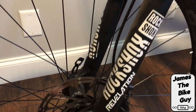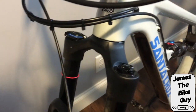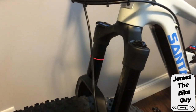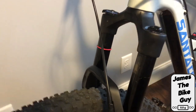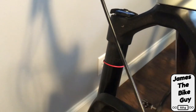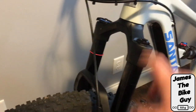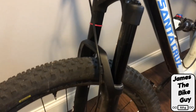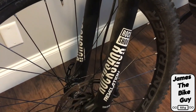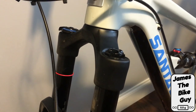In this case we've got a RockShox Revelation — the new 35mm, so this is similar to a Pike. When I was out on the trail getting the suspension set up, the thing I ran into is getting sag set up right. I was able to do that, but in a whole ride that's how much of the travel I used — somewhere in the range of about 75% of the travel, and that means it's time for an adjustment to the air spring assembly. RockShox makes different air tokens inside of there, and we'll go over how to replace those. But first let's talk about why we need to change tokens in an air spring assembly.